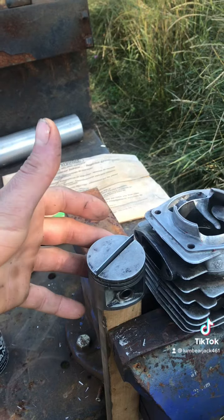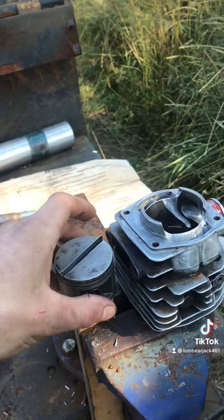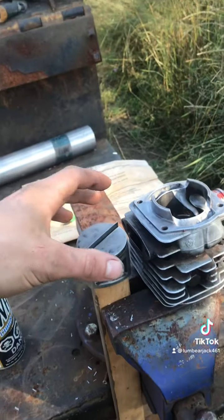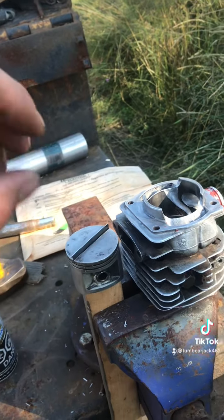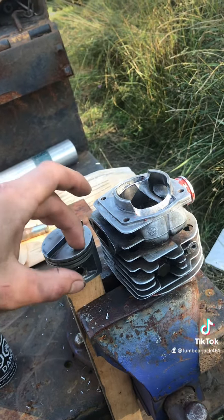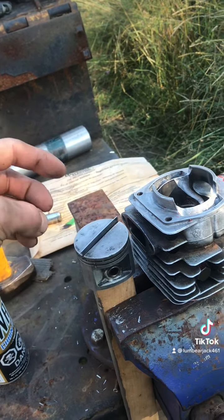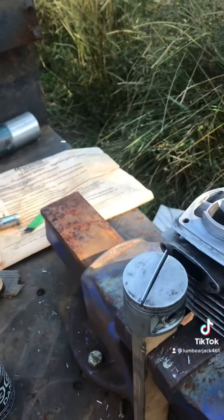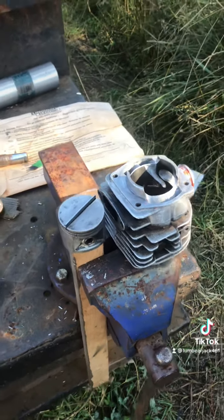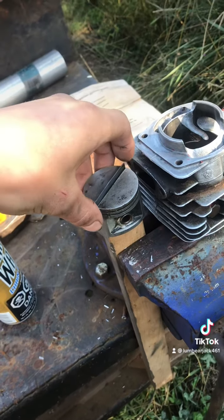I liked what I saw, no pun intended. And so I commented on some of his videos on the topic specifically of blowdown. That's kind of what I was learning about at the time. And then after watching some more of the Novice Lumberjack, he had mentioned that the timing numbers on a 545 Husky were 105 on the exhaust and something like 15 or 12 degrees of blowdown, and the saw was an absolute torque monster. So I changed my direction of inquisition or learning directly right to blowdown and figuring out how to shorten it, what the pros and cons are.